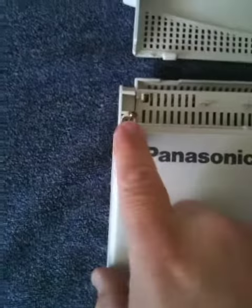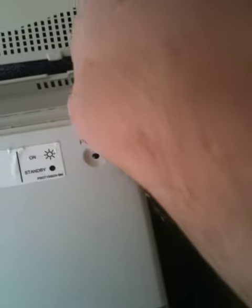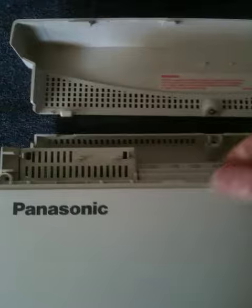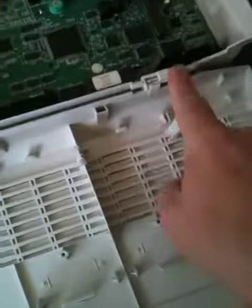On the top left hand corner there is a screw which I've already loosened to make it easier for me during the video. Remove that screw, and another screw here, remove this one. Then this lid should now flip open — it's a little difficult to do one handed, but it flips open; it's got some hinges here. This reveals the motherboard.